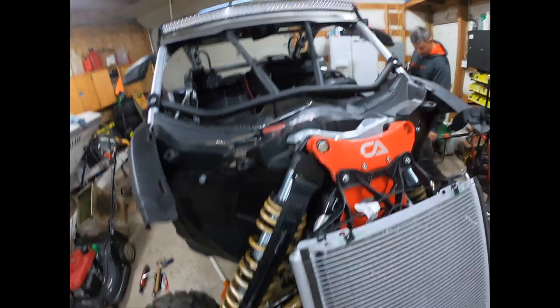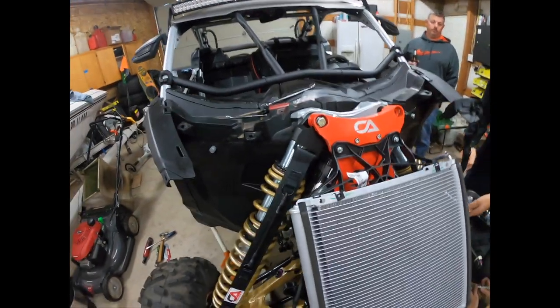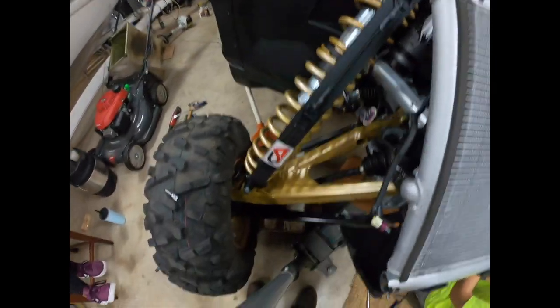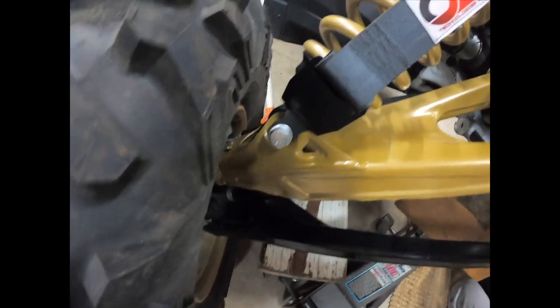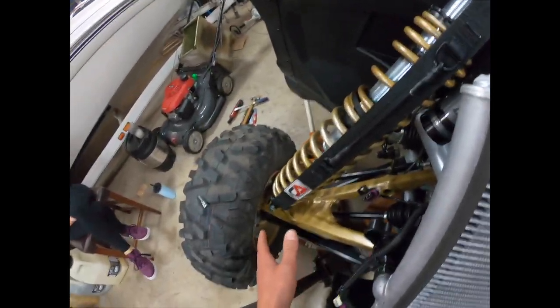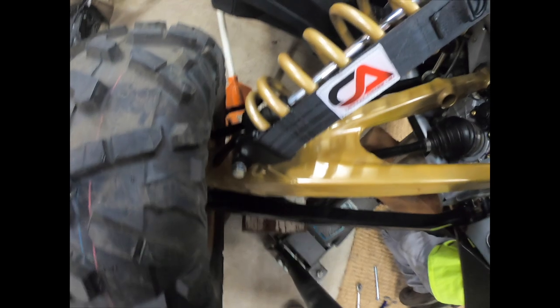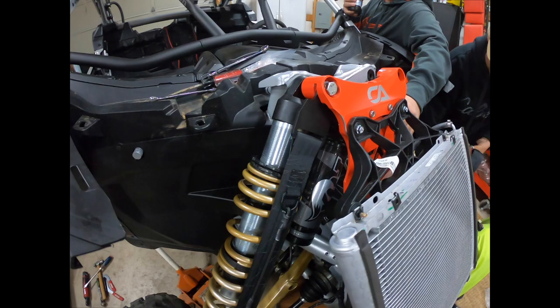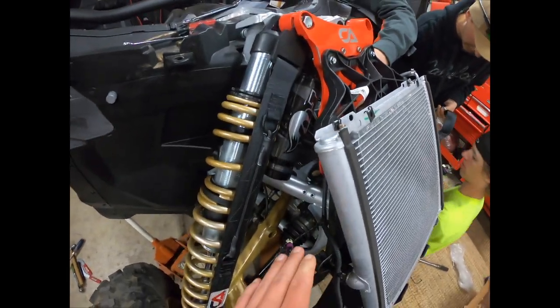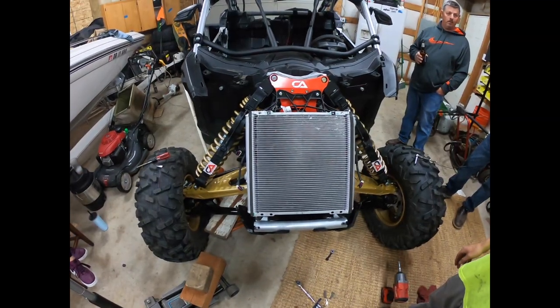We got the first limit strap in. Just a heads up before you start doing anything with the upper shock mount — definitely put it on the bottom first, because if you've got it on the top you're never gonna be able to get the shock back in. It's gonna fully extend when you take the bolt out, so you're never gonna have enough arm strength to put it back in unless you compress the shock. Put it in the bottom first so it'll be a little easier — then you can just lift the car up and get the upper part of the shock right where you want it.